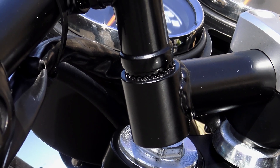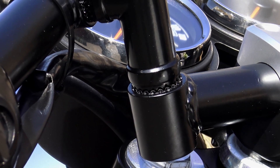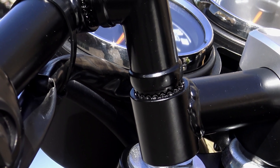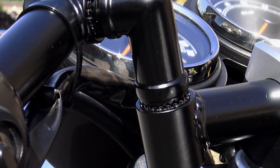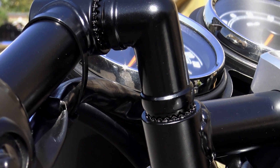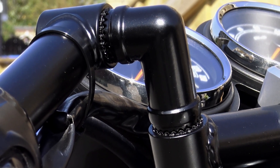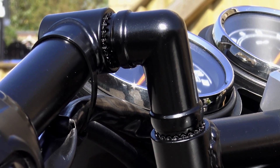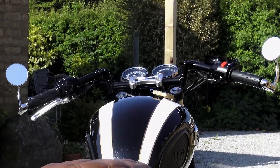Where the different components meet and to allow for adjustability, each component has a male and female toothed joint. Motown have made these teeth a little bit finer than the originals to allow a greater and more gradual degree of adjustability. Each joint is held together with a 10mm stainless steel Allen bolt, and when these joints are tightened up the whole thing becomes solid, just like a conventional pair of handlebars. Each end of the handlebar features adjustment for both drop and reach — a legendary design famous for its versatility and practical use.